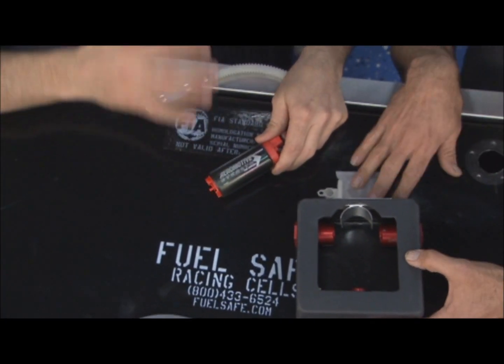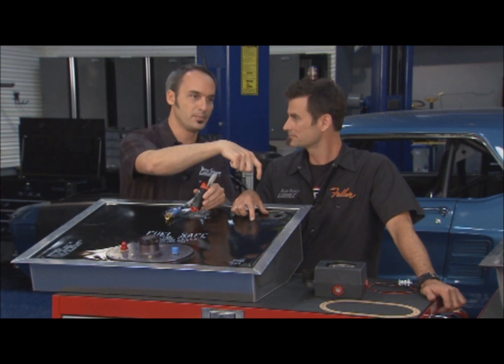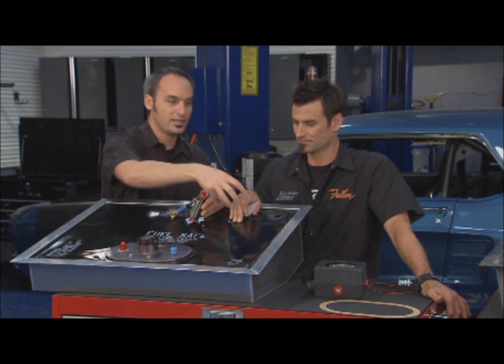Speaking of having fuel at the pump, this is a Stealth from Aeromotive — a 340 liter per hour pump. It's a huge amount of flow for this tiny little guy. We're going to put it inside the fuel cell, which is something you're normally not going to do with a pickup tube feeding to some external pump. Getting it in the fuel cell is really, really important, especially when you're drawing that much fuel. Hot rod guys and racers — everybody has gone to the in-tank pump.